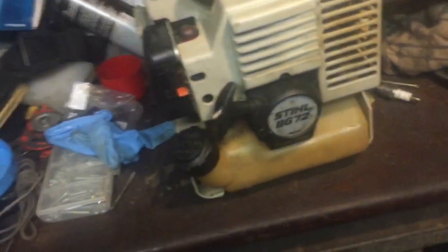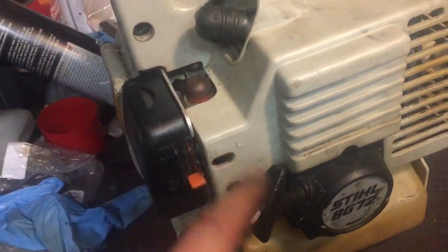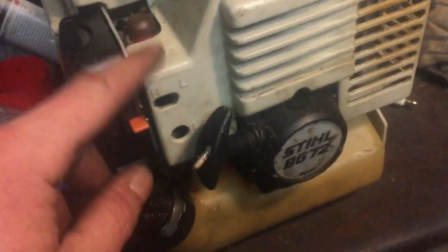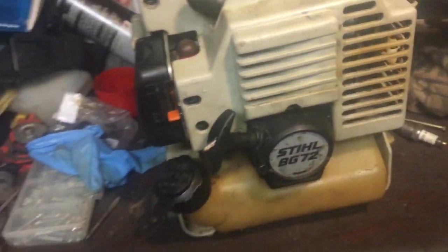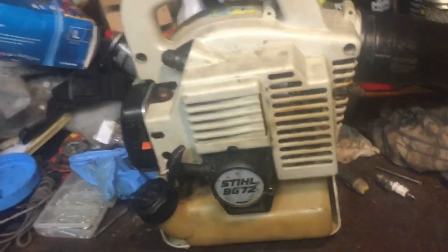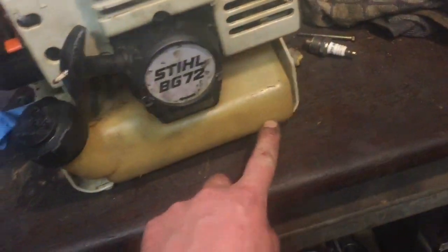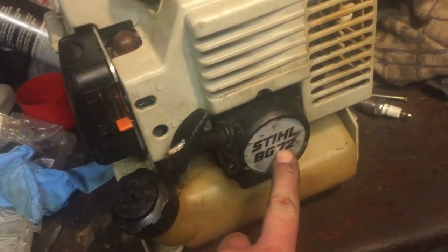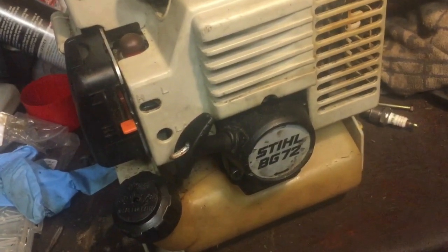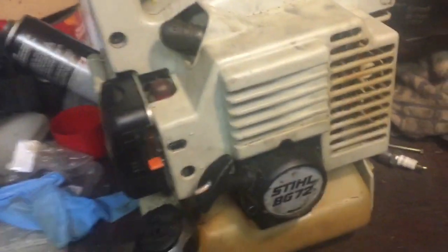Yeah, off camera it was really flooding bad, and I found out at the end that the fuel screws nearly had to be all the way in. They're out less than one turn, both the fuel screws. Usually it's about one and a half, 2. From how I usually set them, I usually unscrew them about 1.5, 2. But this, they hardly got to be out, so in time it might want a diaphragm on it. But we're only up to there on the fuel tank at the moment, so because it's flooded so bad, I put the drill on the nut and turned over the drill, and it sort of cleaned it out, and then it fired up. So because the compression had gone down a little bit now, because when I did the rings I put a bit of oil in the bore, so that increased the compression.